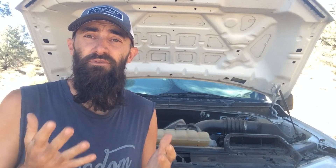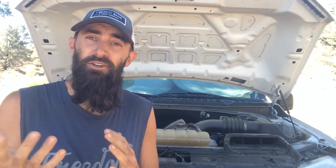Your engine can still run because it's definitely better to run your vehicle with dirty oil than no oil at all. So there you have it — everything you need to know about your oil pan, oil filter, and oil pump. Make sure to check your oil as often as possible; every other time you fill up with gas is a good habit. Change your oil at regular intervals — between 3,000 and 10,000 miles depending on the oil type, how you drive, and your vehicle. Go by whatever it says in your owner's manual, and err on the side of caution and do it more often, because changing your oil is a lot cheaper than replacing your engine.